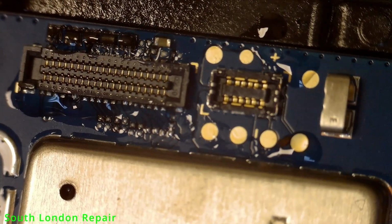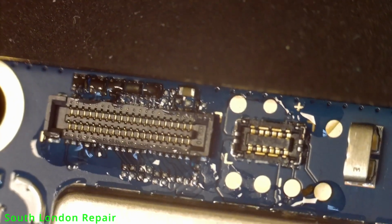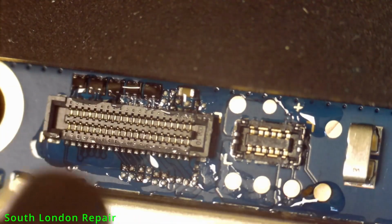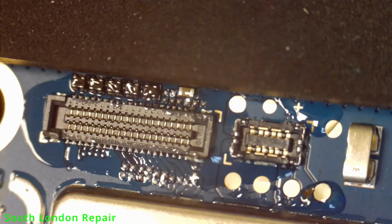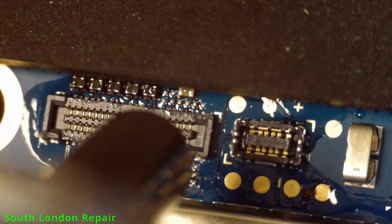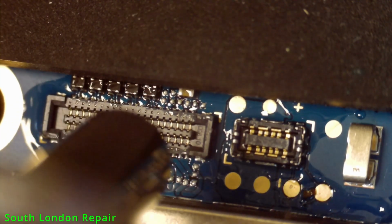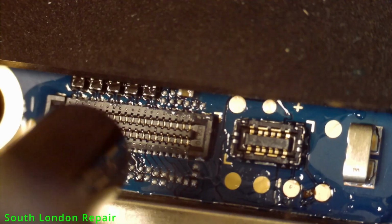So I put a little flux on the external connections. I mean, that is connecting to the main board. Sorry, I tried to find the right angle. And I set up the hot air station to 300 Celsius and 150 liter per minute. Basically that should be enough to heat up slowly the board and the connector, but not melt away the plastic.